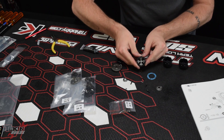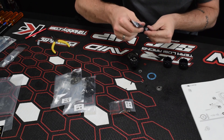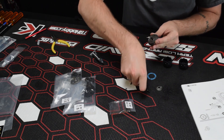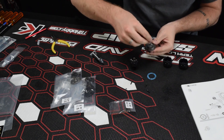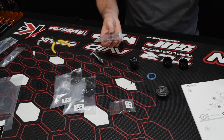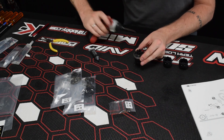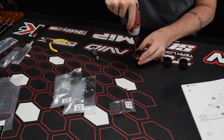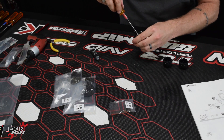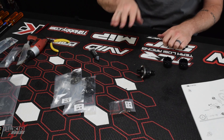This is the ring gear, so put a flange bearing on the outside of here, grease up the other out drive, grease up the o-ring just like we did on the other side. Take your washer, put the pin in, and drop the sun gear in on that side. We'll take our 3000 weight diff oil — TLR specifies to fill this up to where it just covers the spider gears. Got our handy little skill driver; tighten these down. Once I tighten those down, I like to manually tighten these. This feels nice and smooth. That's our rear differential done — we'll just repeat the same process for the front two.